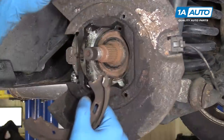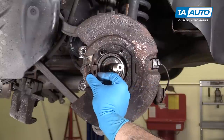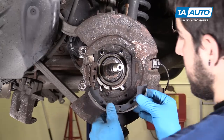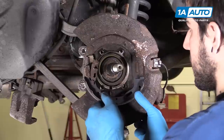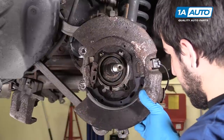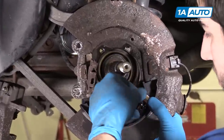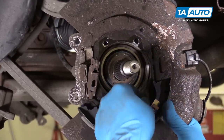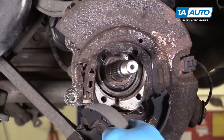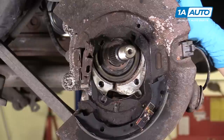With all this taken off, your backing plate is free floating, so just make sure you keep an eye on it and don't let it fall. This spreader has a small hook inside of it which will face up and hook onto the opening in the end of our e-brake cable. We'll then need a pin, a clip, and one of our brake shoes — these are identical, so it doesn't matter whether you put one on the top or the bottom as long as they're facing the right way. Send our pin through the hole in the backing plate and through the slotted piece of brake shoe. Install the clip, compress it, and slide it behind the head of the pin. Do the same thing for the top side. Don't worry about making sure these engage the spreader just yet — there's no real tension on them, so we can worry about that a little bit later.